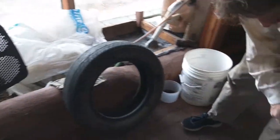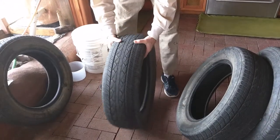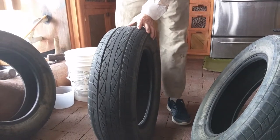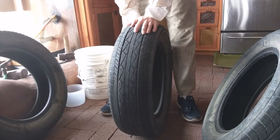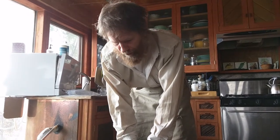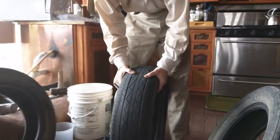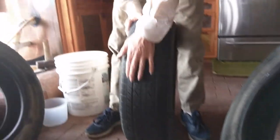The next tire here — I took a close look at the wear pattern and it looks very even. But after doing a 2,400-mile road trip, mostly on highway going up to Montana and back from New Mexico — almost all of it at 80 miles an hour — you can see right here that there's a bald spot where the tread pattern just disappears.